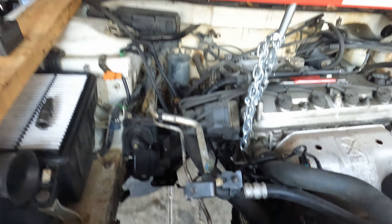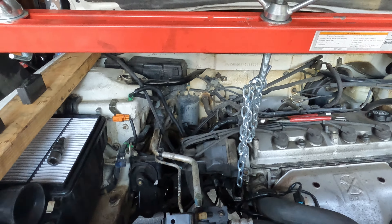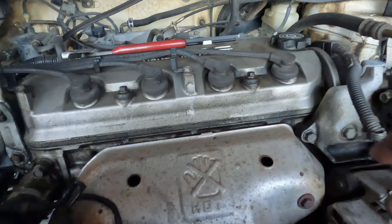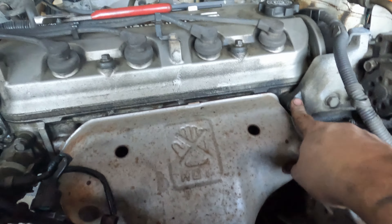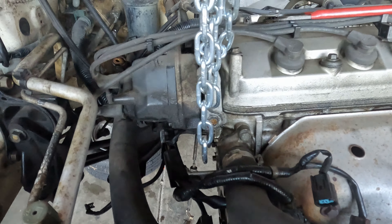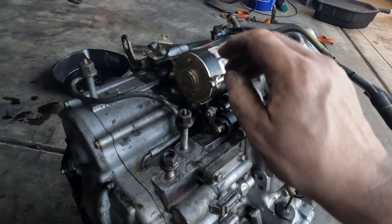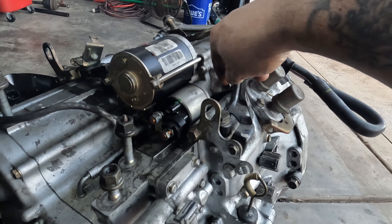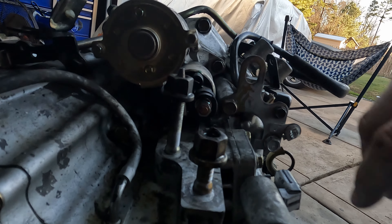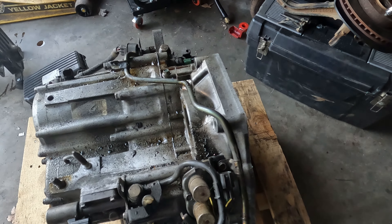As you can see, I got the transmission out. I did use my front-wheel-drive engine holder, and to get enough lift and distance to go up and down with, I had to use a chain that had some length to it. There's a mount hole right here beside the distributor that I put it in just to hold it so you can lift the back up and down. Here is the new one. Like I said, I took the old one out with the starter still on it — it's just two 15 millimeter bolts. It's easier to take the starter off after you take the transmission out so you can get to that lower bolt.